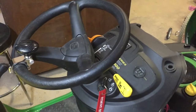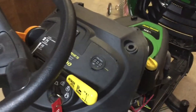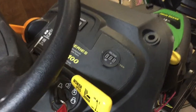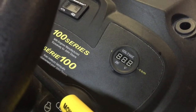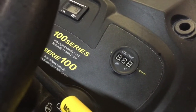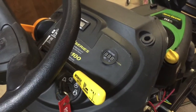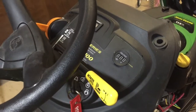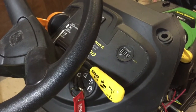As you can see, I put it on the dash using a blank space I already had. I drilled a hole in the dash. This gauge I got off eBay — it's a smaller gauge that measures 5 volts on the low side and 24 volts on the high side. I used a one and one-eighth inch spade bit to drill the hole, which made a nice snug opening for the gauge.